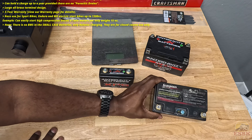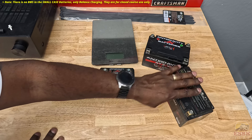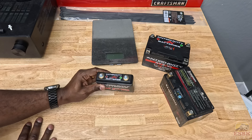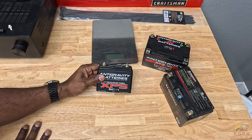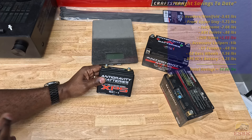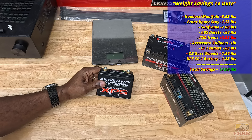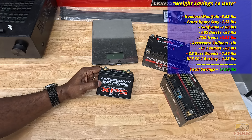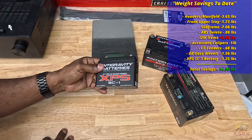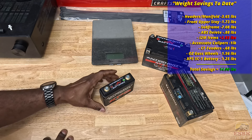There's a video out there of Anti-Gravity using this battery to turn over a big American V8 engine. So this battery has plenty of cranking power — 150 cranking amps out of a four-cell tiny battery. These are typically anywhere from 12 to 16 cells. So I'm really looking forward to this. It should help us out a lot, and like I said, we just lost a pound — the pound that we gained by adding our i2m Chrome Pro 2 stuff or our OZ Racing wheels. If you remember, the rear OZ Racing wheel was one pound heavier than the one that came off the bike. We just saved that weight right here by installing this diminutive tiny little battery.